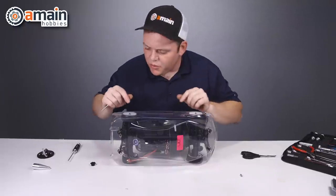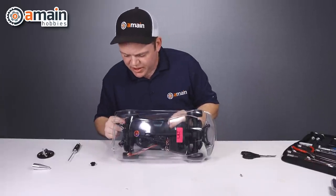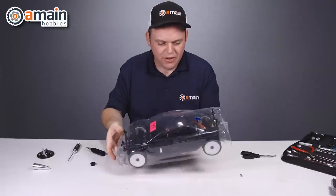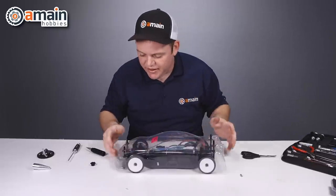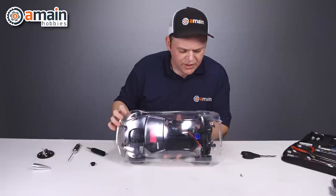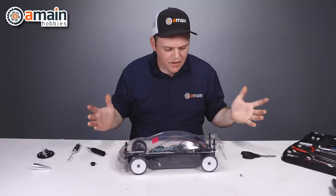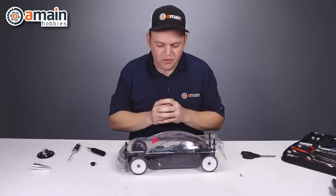I've made my marks on the wheel wells. I'm inspecting how they line up and how much they're off when the suspension hangs freely — it's just a tad. There is going to be a little bit of droop when the vehicle sits under weight, and it'll be heavier than it is now because I don't have a battery in there. But our marks are pretty dang good. The next step is to pull the body off, use the jig on it, and the next time the body returns on the chassis it should have those nice clean arcs in the wheel wells.